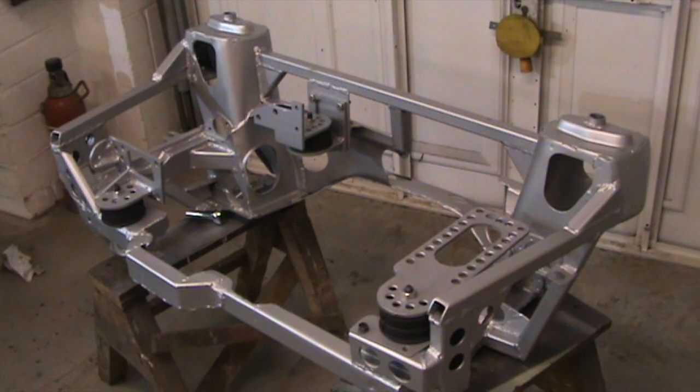So here we have the subframe with the mounts now added, just bolted in — a couple of minute job. To recap: the gearbox front mount here with the bush beneath it, and the rear mount — that's a two-part mount, one's the block, one's the subframe side — to hold the engine. So that's all done.